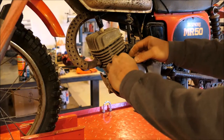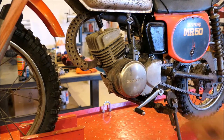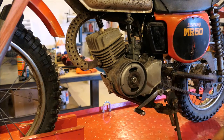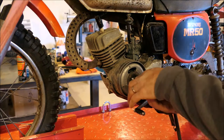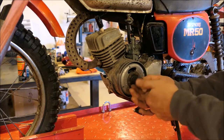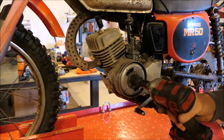Take this cover off first. You need to be careful with this cover — it's just pinched on there with these little things. There are reverse threads on this when it goes into the flywheel. You're not supposed to use an impact on it, so don't use an impact.